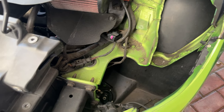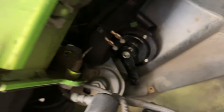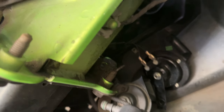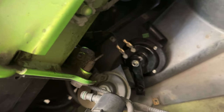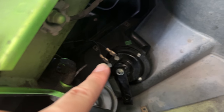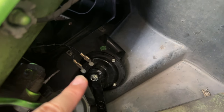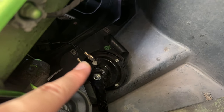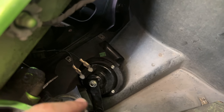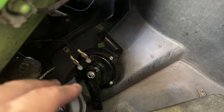Alright guys, so now we have gotten the headlamps removed. I actually did remove the socket for the original horn. So let me give you a look — it's right down here. It's identical on the other side, of course, it's flipped, mirrored. But basically, there's a connector which actually plugs into this horn. And I've actually gotten the adapter so that I can plug in my regular horn. It's so much easier because you can just buy any aftermarket horn and replace it instead of getting one with the connector on the horn itself. So it actually saves like a couple of bucks or more. It depends on what kind of horn you buy.